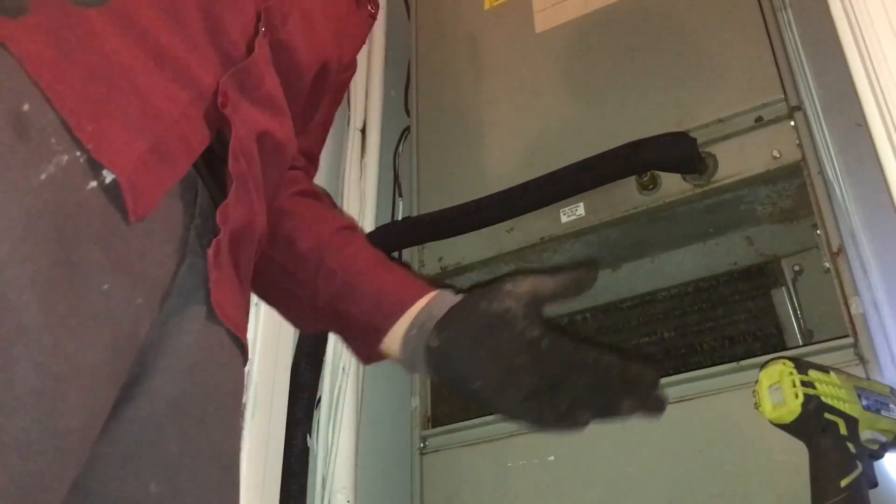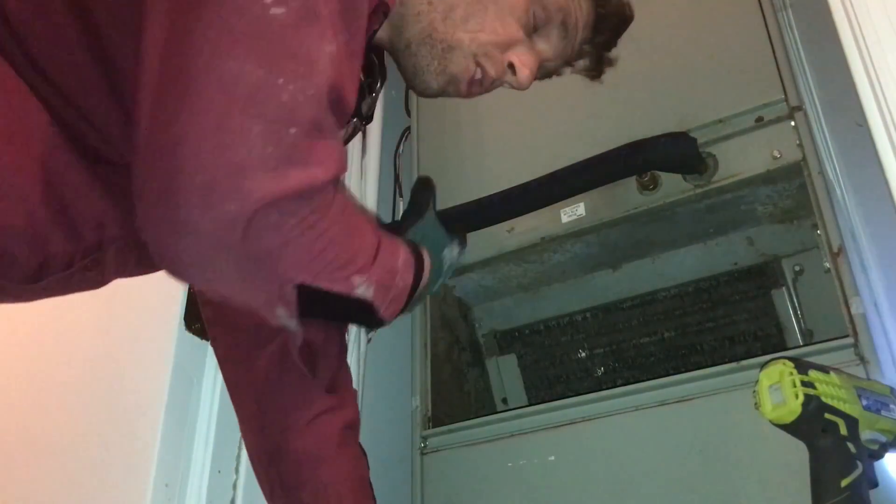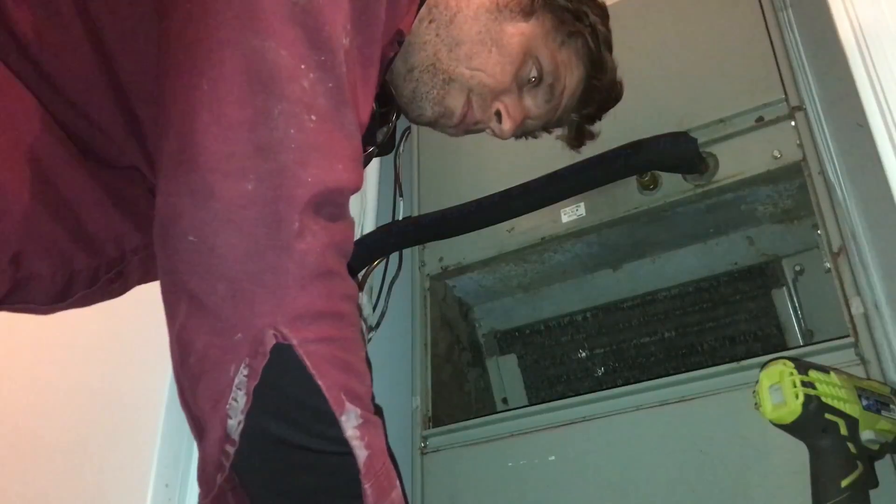Let's find out what's making so much noise in here. You can turn off the blower before you open that compartment so you don't suck anything in or pull the insulation off the door panel, but that's really not very exciting. Let's take a look at that blower wheel together. Yeah, that's looking like exactly why — wobbling. That blower wheel's looking pretty bad.